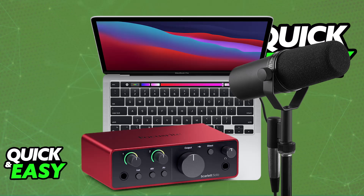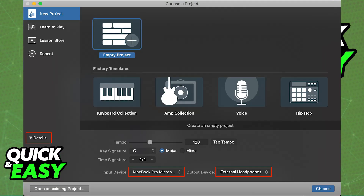With this done, you will be able to set it up. You can open any compatible audio software — for example GarageBand — and in the audio settings, you will be able to choose the audio interface as the input and output device. As long as the audio interface is picked up and the connection was successfully established, it is going to appear under the list of input or output devices, and you will be able to start working with the SM7B.